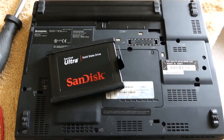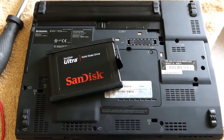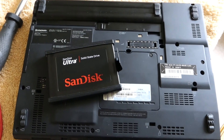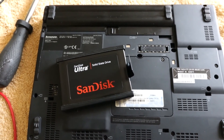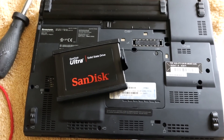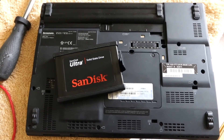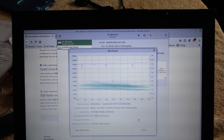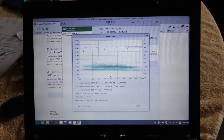Well, it's probably an old one. I don't know where it came from, this SanDisk Ultra - it's probably a pretty old solid state drive. Something to watch out for: if you have got an old solid state drive, you might want to try the difference between that and a USB stick, or an SD card if you can boot to an SD card. Not all computers can boot to an SD card - there's a special adapter that goes into the express card slot that allows you to boot to an SD card. I did a benchmark on the USB stick and it produced 32 megabytes per second and an access time of 1.39 milliseconds.